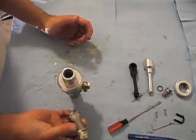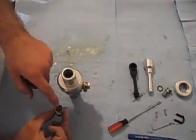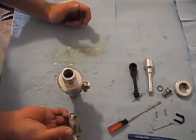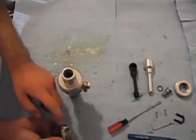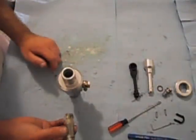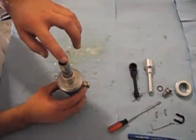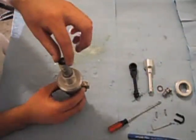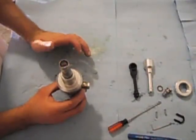Next, you're just going to take the plunger assembly with the dimpled-out end facing up towards you, and the concave part that's slightly recessed going into the master cylinder assembly. Just set this on top like so. What I want to show you here is that there's quite a bit of play — with it not even pushed in, it's just resting here.